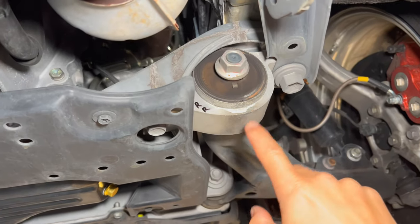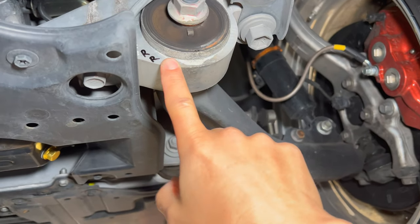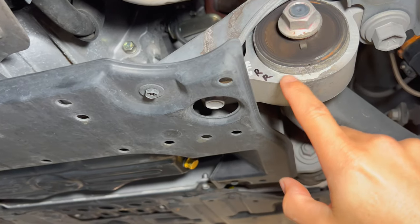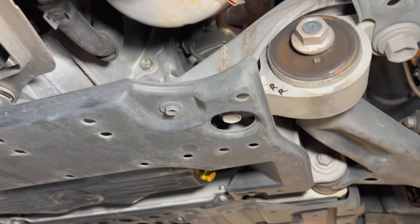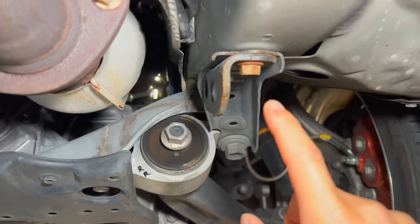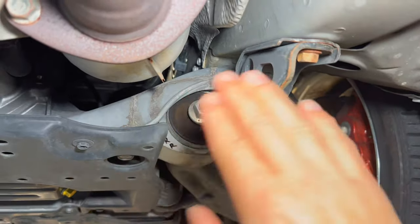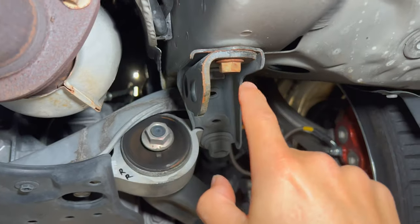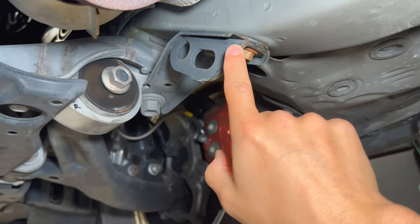We're underneath the car now, and these are the bushings and bushing holders that we're going to be replacing. The first thing you want to do is mark your side. I put RR here, which is the rear right, and over here I put RL, which is the rear left. That way when I press the old one out and press the new one in, I have the orientation correct because it has to go one direction - the collar goes in one direction. I've also got a little bit of corrosion here that looks like battery acid from my old battery that leaked down this frame and got onto these nuts. I'll go ahead and clean all that up and probably replace this bolt, which is corroded and lost all its zinc coating.